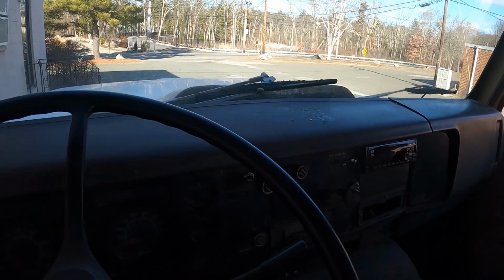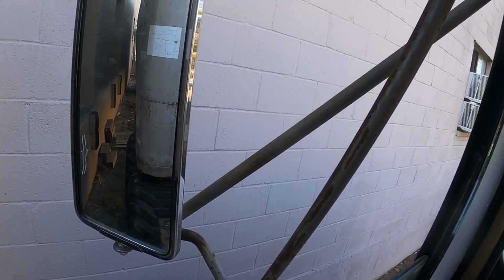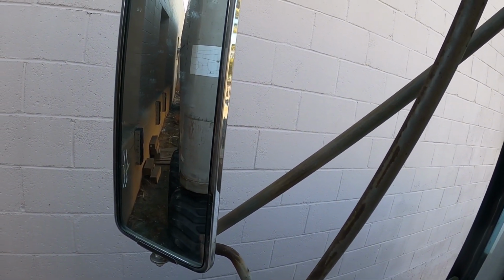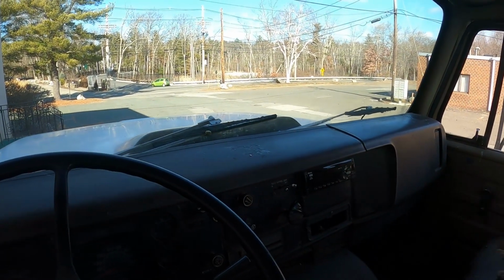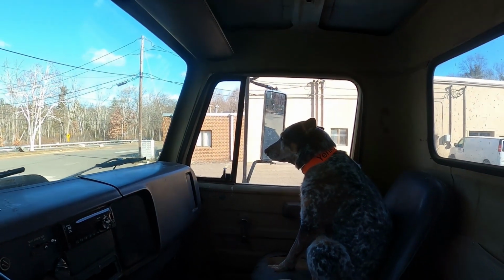What you do first is disengage the truck and try to give it a pull. So we're locked in there, the trailer's still applied, so now we'll release the trailer. What that's doing is actually checking that your kingpin's locked in without driving away and having it not locked in. And well, usually the trailer leaves you at that point, but we don't want that, right?